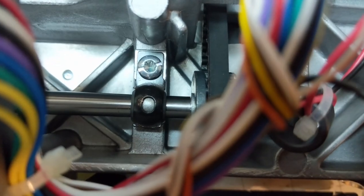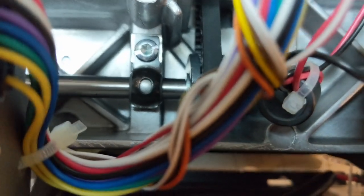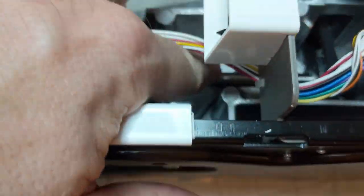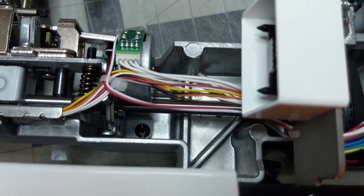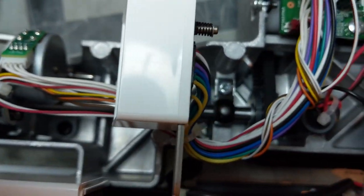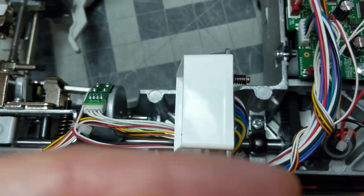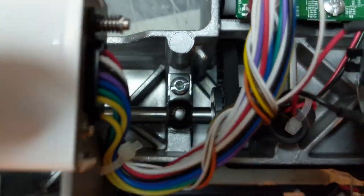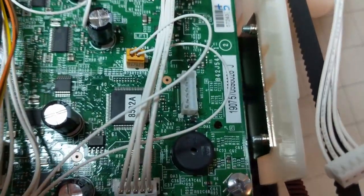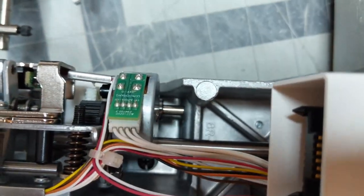This is the bushing that I was talking about on these machines — one we've had problems with in the past on relatively newer machines. The real problem, I think, when I look at those machines and see all the rust on these shafts, is the fact that the chrome plating on them is so thin that rust just works its way through over time. When that happens, the rust rotating inside that bushing just eats away at the bushing. It causes the motor to have to work really hard, drawing more current than what's programmed in that little brain right there, which throws a code and stops working. You just get a little code on your screen that says it's done, and you've got to figure out why.